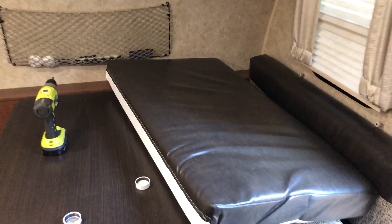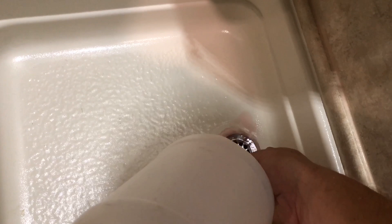The only other thing I do as a safety precaution is take my leftover fluid and go around and pour a little bit more in my drain traps. One of the drain traps we tend to forget is the shower drain trap. Don't forget that the last time you used your trailer, if you used the shower, there's water down in there. So we're going to put a little antifreeze in there just to keep that drain line from freezing.